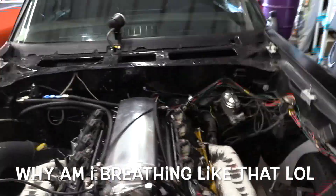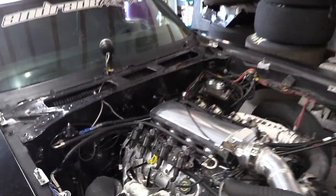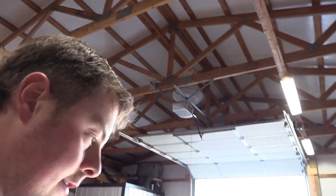All right, got the new plug wires on — don't pay attention to the mismatched color. I didn't want the exact same thing to happen so I built these brackets. We're going to go driving and see what happens. On a phone call: I have a 120-degree angle plug wire on it and it was still bending and touching. What took me so long is I built aluminum brackets to space up the coils so they're all straight — none of them are touching the headers. I wrap this side in silver and this side in gold heat wrap.